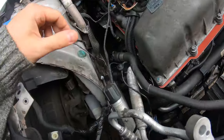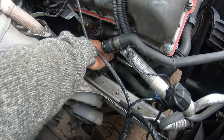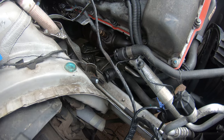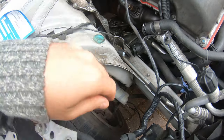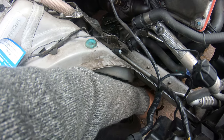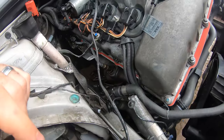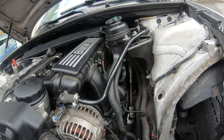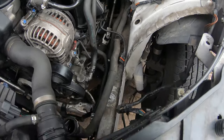We need to plug back in the wire for the fan and the wire for — I'm assuming that's a temperature sensor for the coolant. I plugged in the headlamps. This is for the reservoir right here. We're gonna put the intake back on with all its hoses, hook up the map sensor. Make sure everything's hooked up. Make sure the AC lines are hooked up down here even though we're not gonna use them yet. Fill it with water, fill it with oil, put the bumper back on, hook the fog lights back up, fill the power steering fluid, and we'll have to purge that later when the car is started.